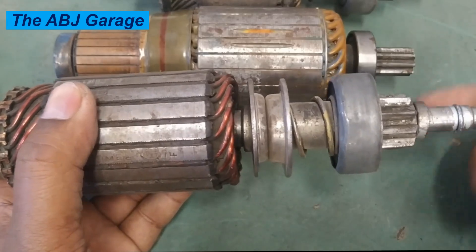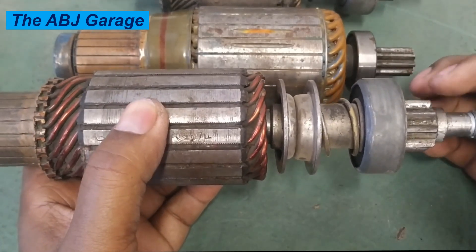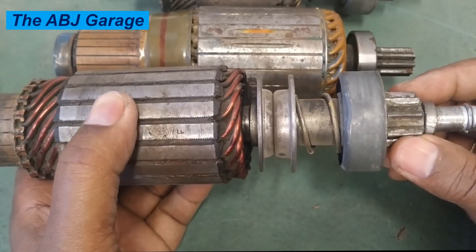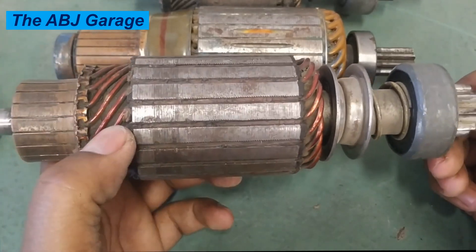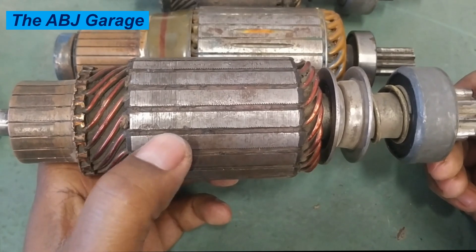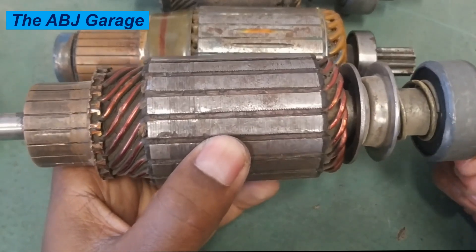Because the engine flywheel or flexplate has multiple teeth, when that large number of teeth is rotating, those tiny pinion teeth will accelerate the armature at an extremely high speed. That can cause centrifugal damage — the centrifugal force will damage the coil and can lead to fracture of the armature as a whole.